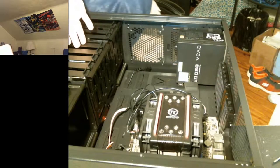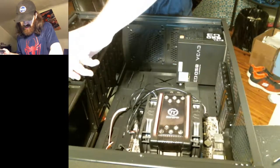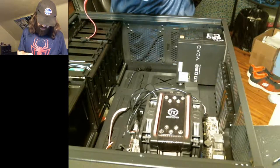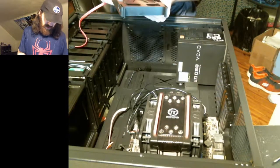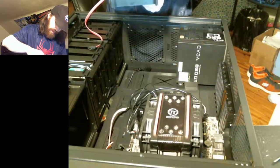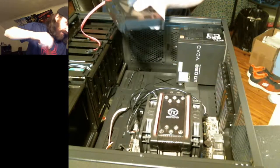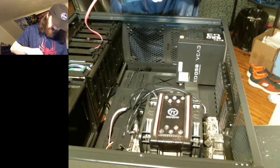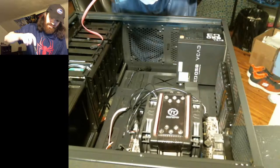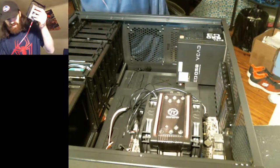Now, reach out here, got my SSD down here. And pop this in. I see, it lines up perfectly. Find some screws. And since this is an SSD drive, you really don't need that many screws. Two is sufficient. I mean, yeah, you can put four in there if you want to, but you really don't need to. Because remember, no moving parts. Where are they going to go? Somehow grow legs and arms and undo the screws? That'd be hilarious. Anyways.